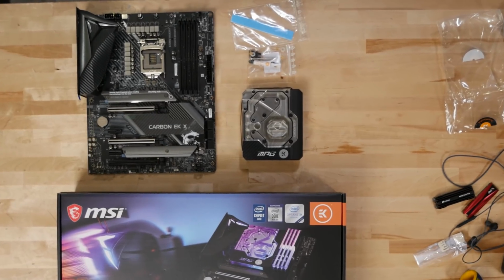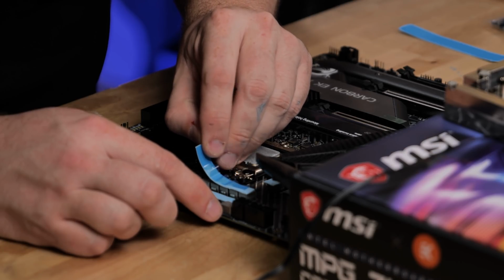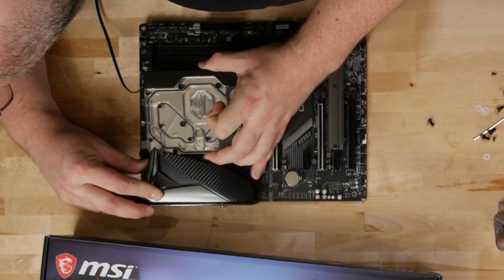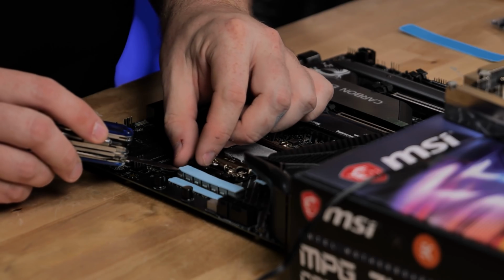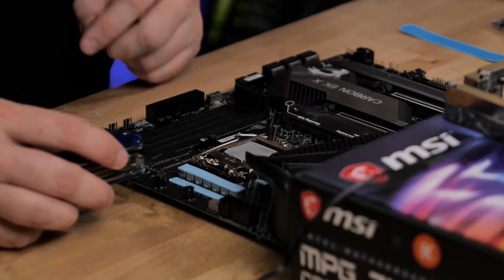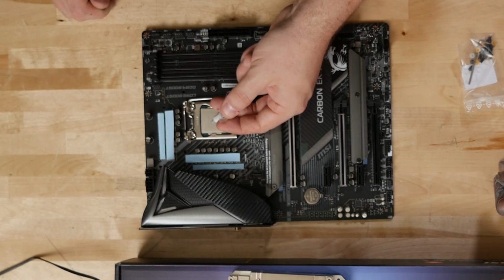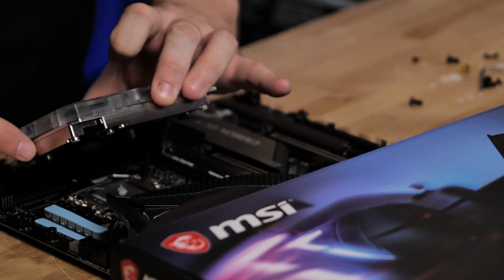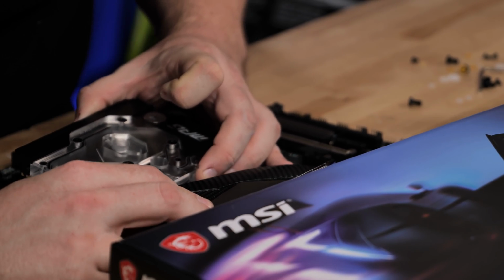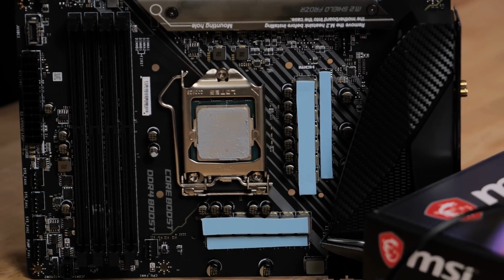One thing that you will need to pay special attention to is that the motherboard comes with spongy thermal pads, and you will want to install the spongy thermal pads on top of the chokes and VRMs for your motherboard cooling solution. So the monoblock is going to sit here on top of the CPU, and you're going to have to install the thermal pads on the bottom there so that you get proper thermal contact between the monoblock and the VRMs. And then you use regular old thermal paste for the interface between the CPU and the monoblock. See, the thermal paste in the CPU is much closer. It's basically metal on metal in an ideal world, with the thermal paste filling in the gaps from CPU to monoblock. But you're going to have to rely on the thermal pads for the mechanical interface between the VRMs and the chokes for the motherboard.